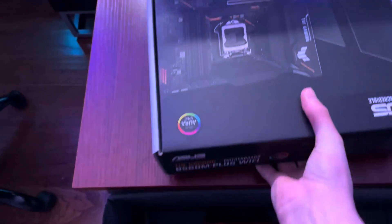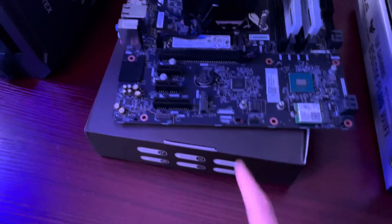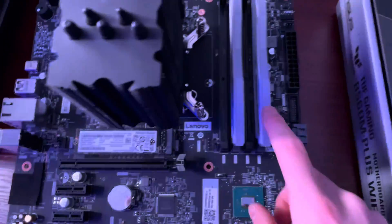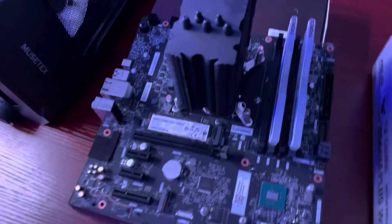I'd suggest moving the case over a little bit and grabbing a second cardboard box — one for the motherboard coming out of the case, and one for the new motherboard. I already took one of the fans off so I can get the cable through, but you'll want to take both fans off. If you only have one fan on the cooler, even better. Now take the RAM sticks out and your SSD. Make sure you don't lose them. I'll take those out and then remove the cooler and get the CPU out.